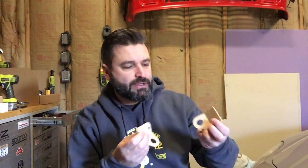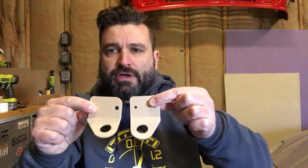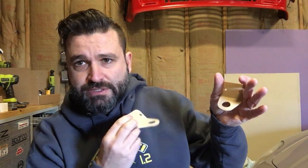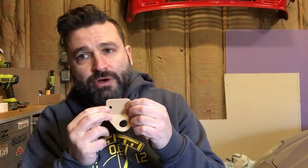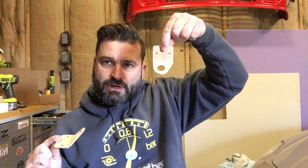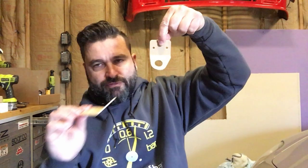The way I went about this is I first designed the brackets in 3D and, because I have a 3D printer, I printed them out with some old material I had on hand. This is the design I came up with — the left side bracket mounts onto the side gate, and the wider one mounts onto the tailgate. I'm reusing the existing holes that already hold the latch in place. When the tailgate closes it sits at 90 degrees, with a chain connecting the two brackets.